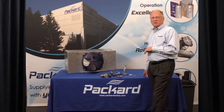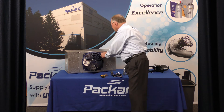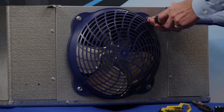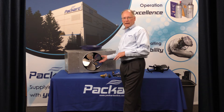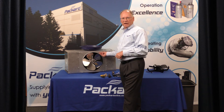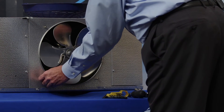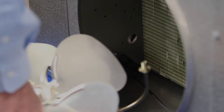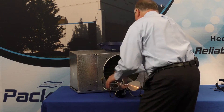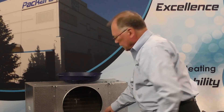Let's look at the steps of removing the old assembly and installing the new assembly. First, we need to remove the guard. After removing the guard, there are typically two retainer nuts — perhaps more — holding the device in place, so we'll remove those retainer nuts. Then remove the fan assembly, and we need to remove the electrical connection within the assembly. The unit is now removed.